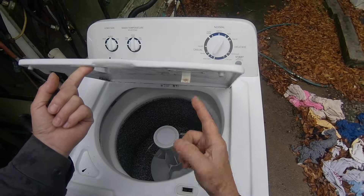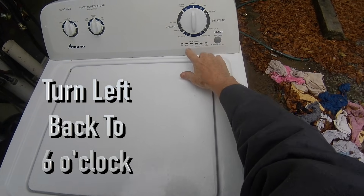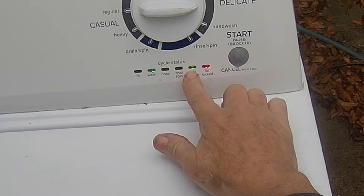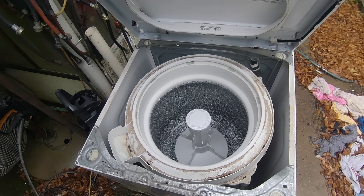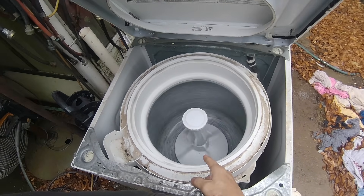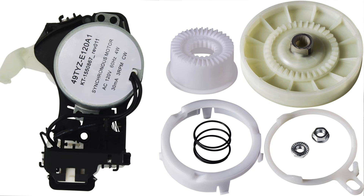To test the spin and agitate functions, we'll need to lock the lid first. Take note of the current dial position, then turn it counterclockwise until all the LEDs are off, and push the start button to lock the lid and illuminate the red lid lock LED. Turn the dial clockwise back to where you were, then two more clicks until the Wash, Done, and Lid Lock LEDs are all illuminated. When you push start you should be in low spin mode. You can raise the top to observe the inside — it may take up to a minute for the shift actuator to position the splutch for the spin cycle and for the motor to spin the basket up to speed. Push start again to stop the test. If it failed, you may have an issue with the shift actuator or the splutch mechanism. If it passes, you can likely skip the high-speed spin test, as passing low spin almost always means passing high spin too.